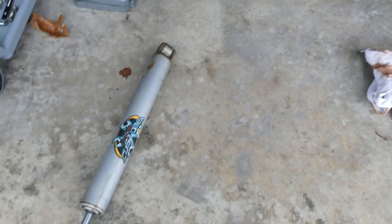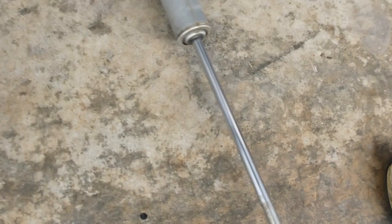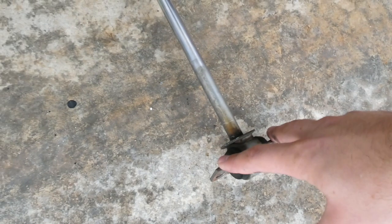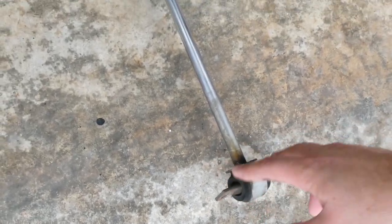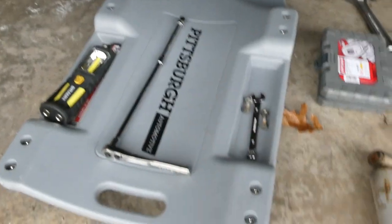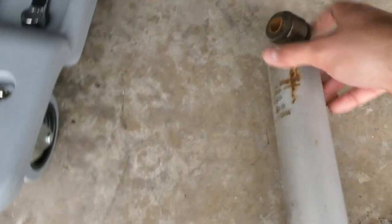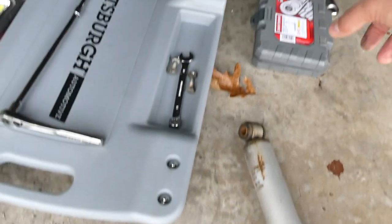Your shocks will have just two different style mounts on the rear. These are the Rough Country ones that came with the lift — they're kind of dirty and getting worn out. They're not the best riding shocks in the world, which is why I wanted to replace them with the Bilstein. You've got this mount on one side — for the driver's side it mounts on the top. It's just two little bolts, I believe they're 13mm, and then a 22mm bolt on the bottom that you remove with a crescent wrench.